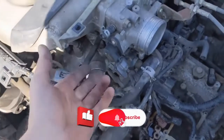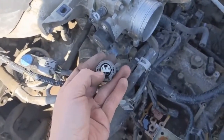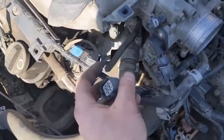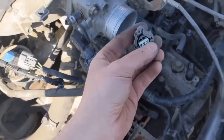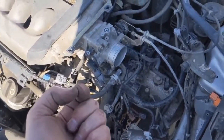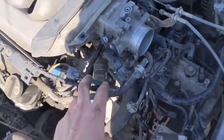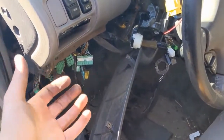This is the throttle position sensor. In order to check the harness side of this sensor you need male blades to go into these female terminals. Same with over here — the EGR — you need male to go into these female terminals. Same with this other connector; that's very typical. A lot of sensors will be male on the sensor side and the harness will be the female. So where can we get the male terminals to build our kit for these female connectors?